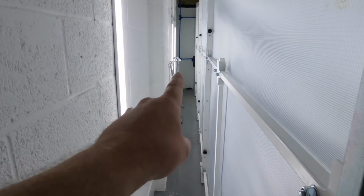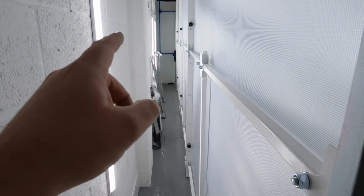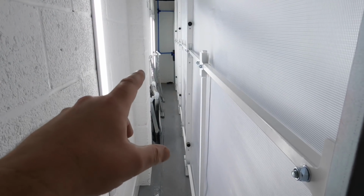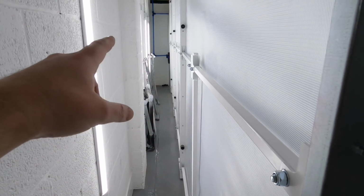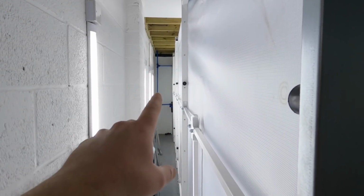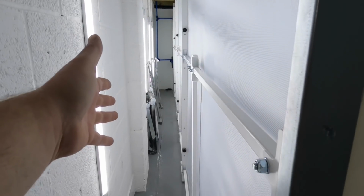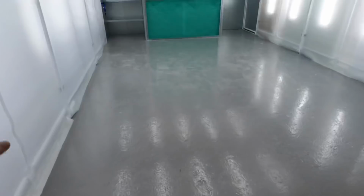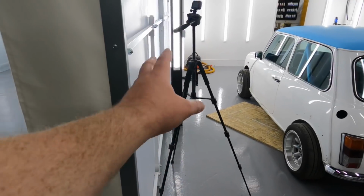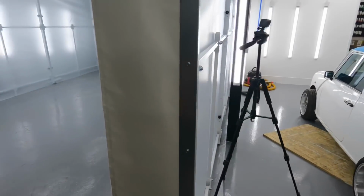So where my filters are at the end of the wall, I went for a Prevost filter system, a three-stage breathable system. That's down there on the wall, but where the electricians were putting lighting in above the mezzanine and everything, there's all sawdust around there. So I don't want the booth to suck it all in. So I'm going to get that cleaned, get this cleaned, and then down on the other side, all in there. I'm going to get all that cleaned, get the roof blown off.